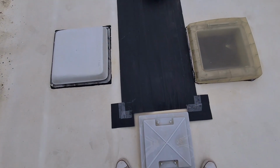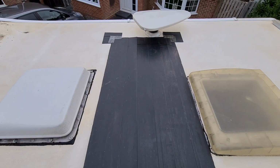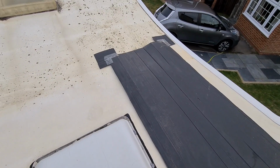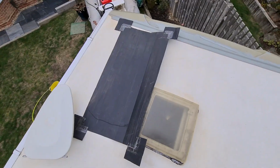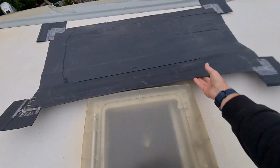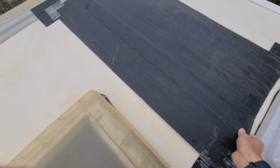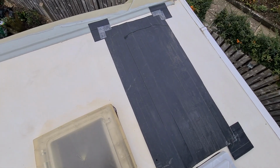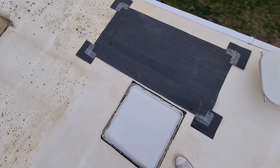We've almost got a space there underneath the aerial, and again we've got space on this side, but it's just going into the curve. We're not going to get one there. Doesn't look like we're going to get one there either. The last space available is there, but again it's still touching the back. One there and one there, and that will give us 200 watts.